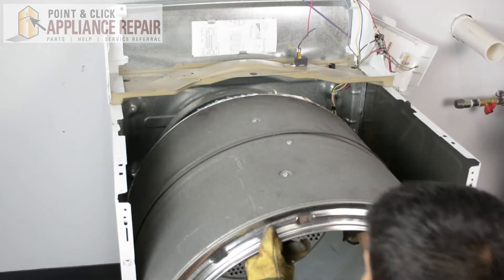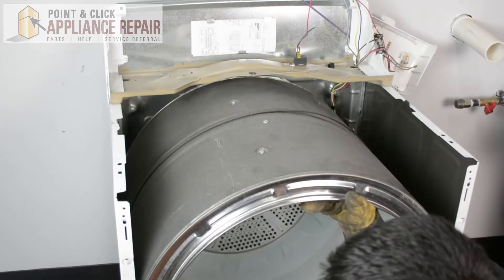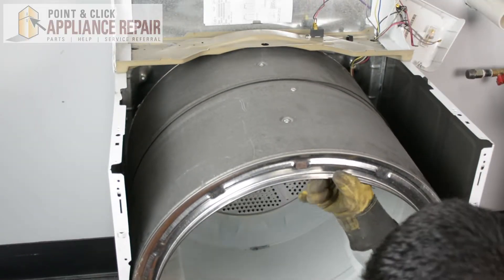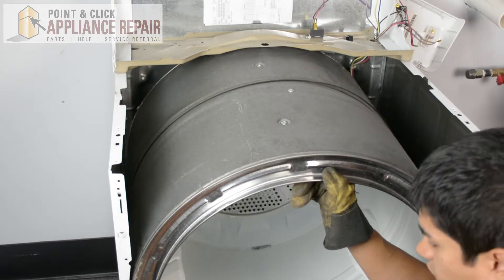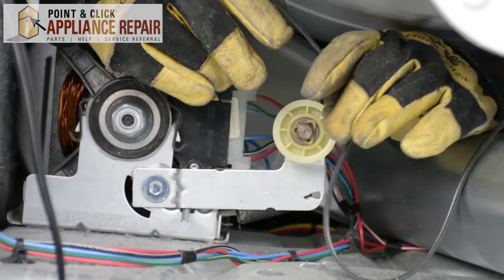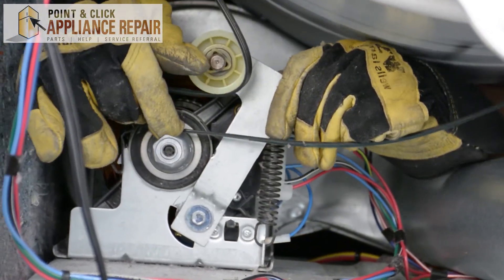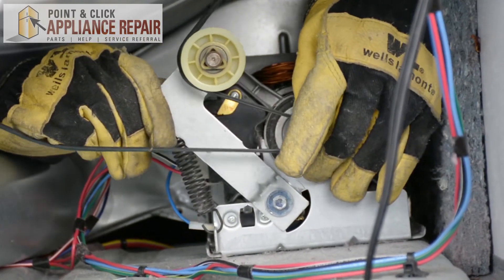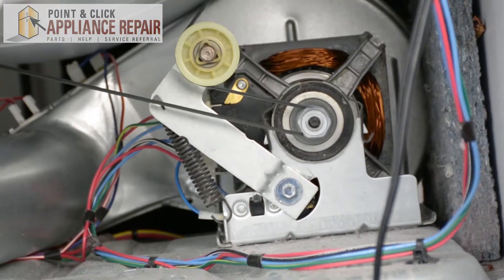It's a little bit hard to line it up when you can't really see it back there, but do the best you can — it might take a couple of tries to get it exactly in place. You'll see that the rim of the drum is inside the frame of the dryer. Now to put the drum back on, we're going to take the belt, go on the other side of the wheel, lift it up, and loop the belt around the shaft. Make sure everything is on straight, and then everything should be able to spin freely.